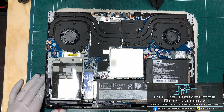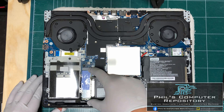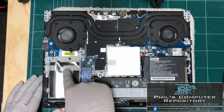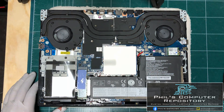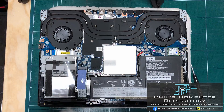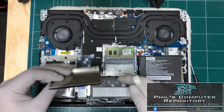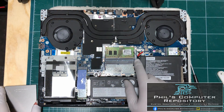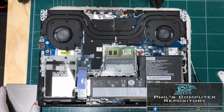Now we're in. Let's look at what's inside. First we see the M.2 SSD that is standard in this model, we see the tray for the 2.5 inch hard drive which we're going to be using, and we have memory slots which are underneath this metal plate. I'll use my plastic wedge to get at the edge and take it out. You can see there are two memory slots, and this model has a single 8 gig stick which we're going to take out and replace with two 16 gig sticks. We're also going to be putting in a 1 terabyte hard drive.